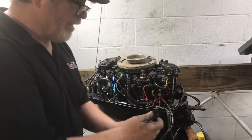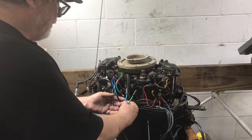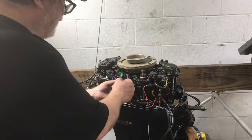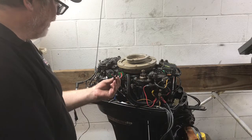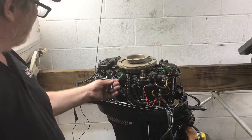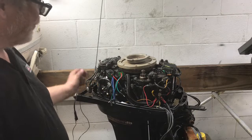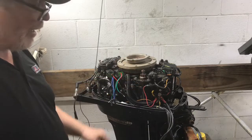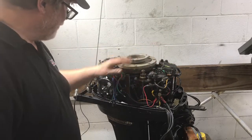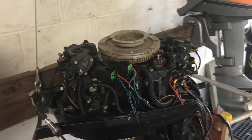I've got a couple of bullet connectors here that I've got to hook up. This would actually go to the blue and the green, but I've also got the harness that actuates the throttle control, and the tilt trim switch is here. I need bullet connectors for these that I have to go get and connect up. Once that's done, I can test the motor. I've got good compression and good spark — I just don't know about the carburetor yet, but when I get the jet in I can put it all back together and it should be good to go.